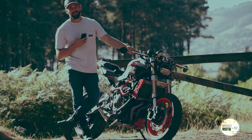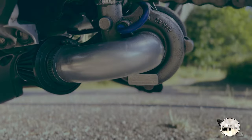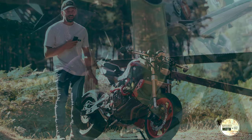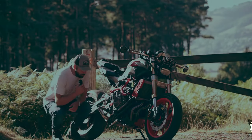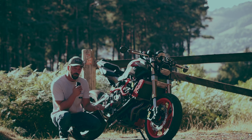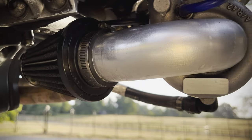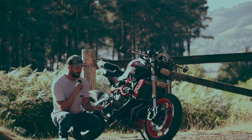What we're actually here for is the turbo. This has a modified GT15 turbo with a 7.5 wastegate actuator built into it, created and modified by Ben at Extreme Creations in Australia — you can purchase this product straight from his store online. It goes like the clappers: from 65 to 70 brake horsepower up to 120 brake horsepower, running at nine pounds of boost tuned into the bike. It's crazy.